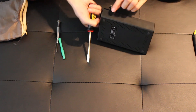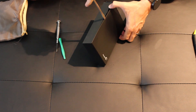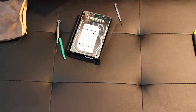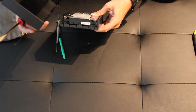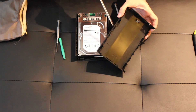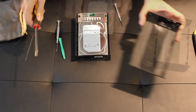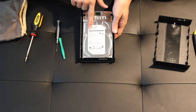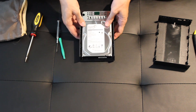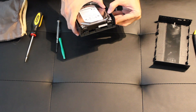There we go. There's more clips on the top it seems. Let's just go through there and open it up. There we go — and it's all off. So I've gone into that pretty hard, as in I haven't really cared about how I've opened it, and I do believe this is completely salvageable. You can see how these holes line up with things on the enclosure, and if I wanted to, I could just slide that straight back on. So here we have a 4TB drive. Typically they're tool-less inside here. I don't know the exact specifications of this drive, but in all likelihood it's going to be about a 5600 RPM drive. I tend to prefer that anyway for bulk storage — I don't need my drives spinning real fast to keep movies and spare stuff on it.